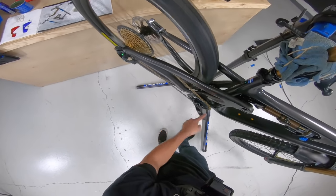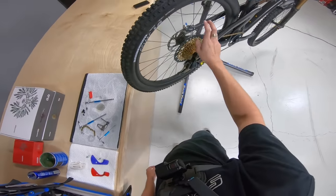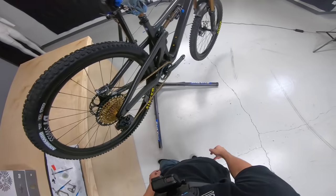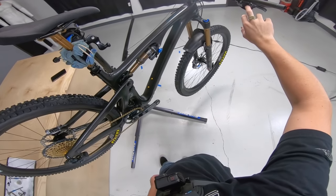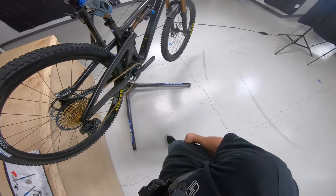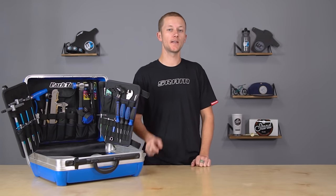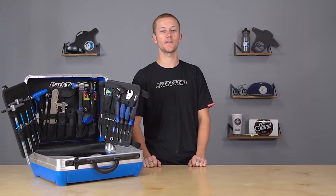And there we are — our AXS is installed. We're adjusted, derailleur adjusted, limits set, B-tension set properly. Once the rider gets here I'll redo it under sag, but it's good to go in the stand and we're all paired up. For last adjustments like burst shift mode or swapping shift direction, use the app. Enjoy your wireless shifting — it's a treat. Hopefully that was useful and you can now install Eagle AXS on your own. Let us know in the comments what tech tips you want to see next, and click the link at the end of the video.